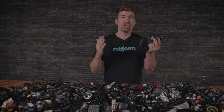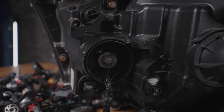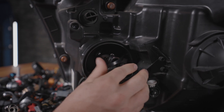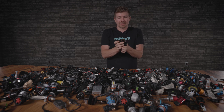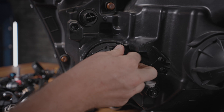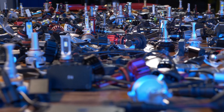If you want something extremely bright, it's generally going to have a fan, and most times if you have this in a headlight housing you can use a dust cover on the backside so you don't have the issue of the fan not working. You can shove the driver — if it's not a big driver, another thing to look out for — inside the housing, plug it in, and then put your dust cover on the backside. If you see something on Amazon with really good wiring but a huge fan that probably won't even fit inside your headlight housing without the dust cover, the bulb is probably not any good. Save your money and be cautious.